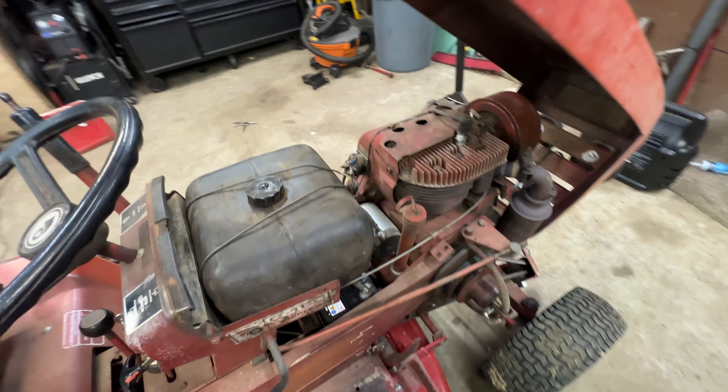But what it does work correctly on is lawnmower engines, chainsaws, and so forth. We're going to go ahead and demonstrate it real quick. So we come over here to our C160, go ahead and pop the hood, and we're going to clip our extension lead on the plug wire — like so.